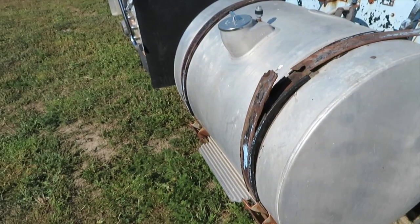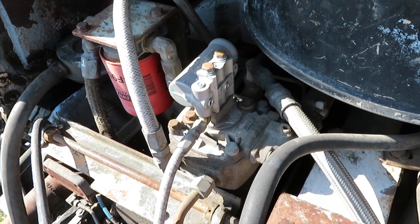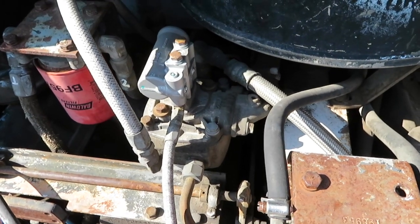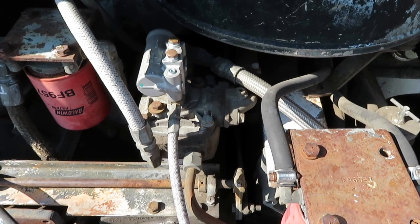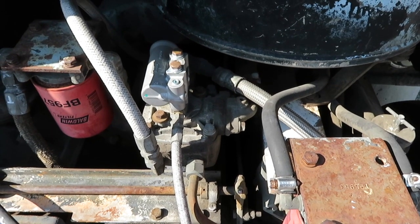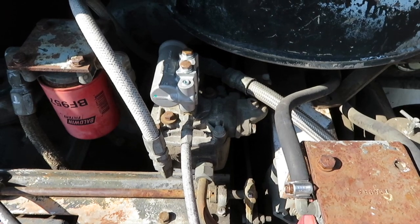So yeah, that happened. I replaced the governor on the air compressor as well. I was relieved to find that when I replaced the air tanks, they weren't really full of gunk or oil or anything, which is a good thing. Someday I may rebuild the compressor, but I don't feel a need for it right now, as long as it's not filling up my air tanks with oil. But I did go ahead and replace the governor because it was easy, just bolts on the top there.